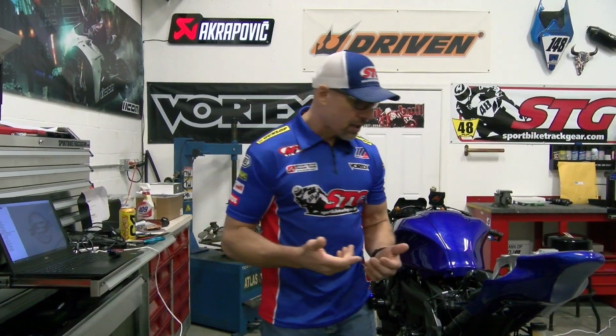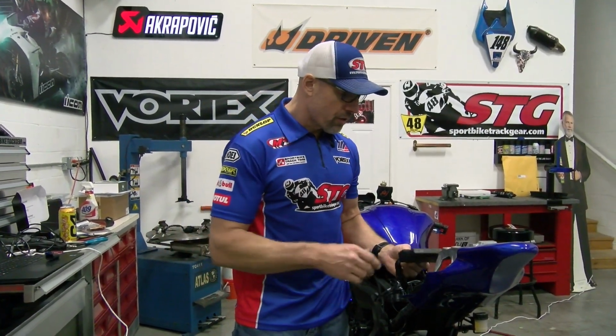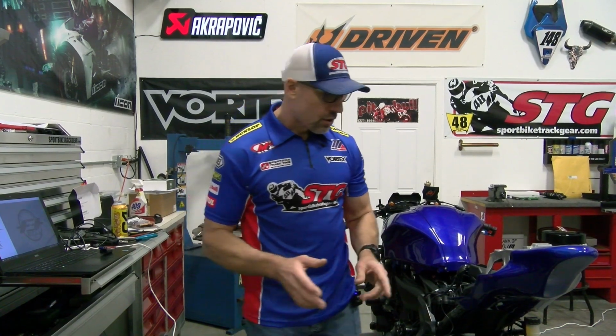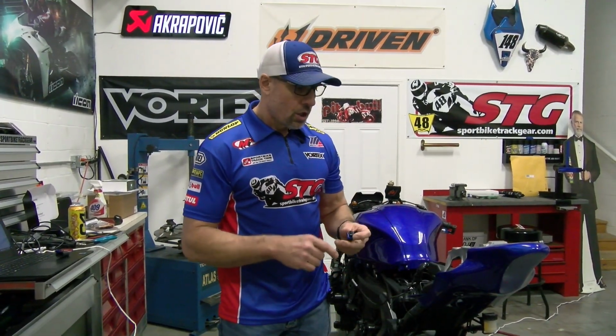And during all of that, I had the ECU unplugged and the ignition off. A hard reset is going to be when the ECU is completely separated from the system and there's no power going to it at all. It's a full reset. When I did that and then performed the hardware test, every time I performed the hardware test, the fuel pump would not cycle, which indicated the hardware or the install was good.